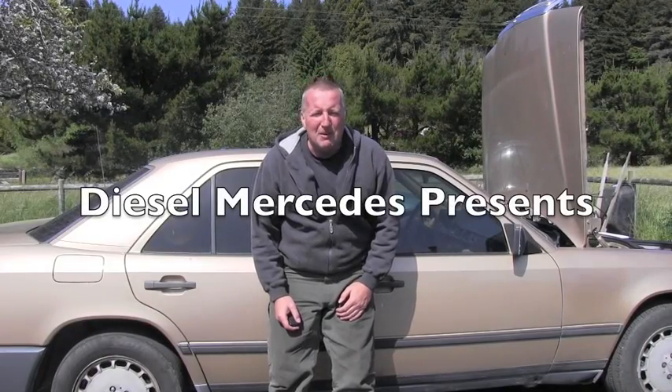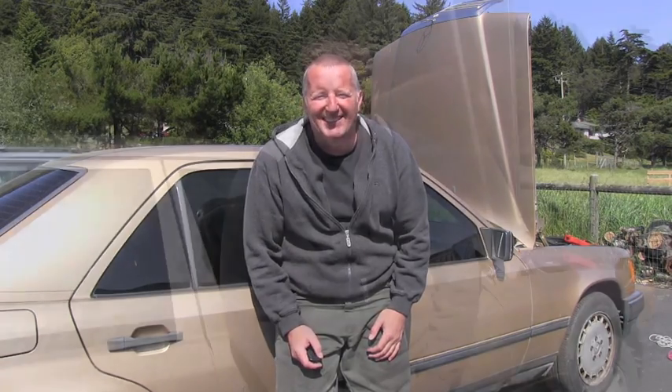Hello friend! Welcome back to Diesel Mercedes channel. In this video we will do a little bit of electric troubleshooting and it will be about the famous over-voltage protection relay, which is sometimes called K1. This relay is supplying electricity for a lot of consumers which are part of the electronic diesel system, and therefore it can cause a lot of troubles. So let's go together, look where it is located and how to test it.